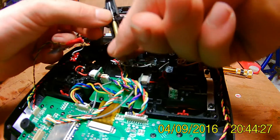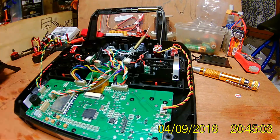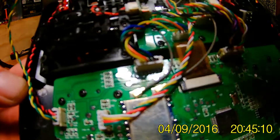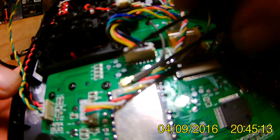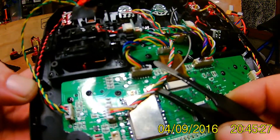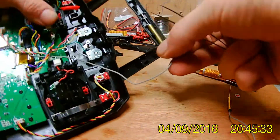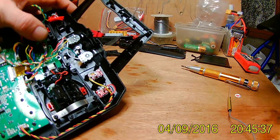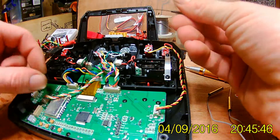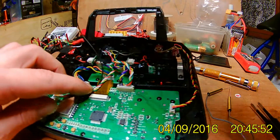I will take this one out — the other one literally runs down. You can follow the wire down; it comes down and clicks onto the board. Just pull it off. This one's just underneath. Then take the one out the top of your handle — that's the two antennas removed. You've got to fit these new connectors into place; they'll just click straight onto where we've just taken them off, one over onto there and then one over the other.